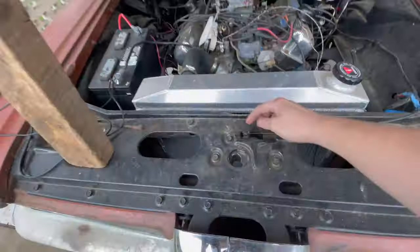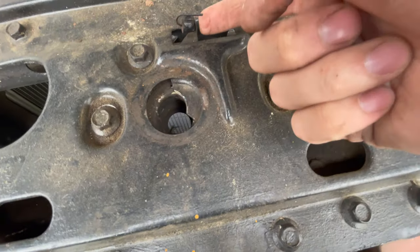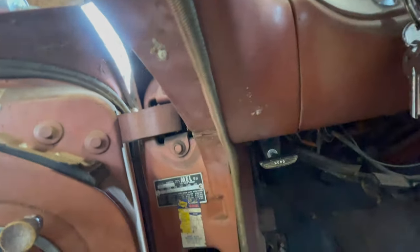We're going to go in and make sure the hub is totally tight. My uncle's here in town — he's done a bit more of this maintenance stuff than me. After that, we need to look at getting the hood to close because it still doesn't close. I think it's this cable — it's just hanging up, not doing the release properly, so when you push the hood down it doesn't have enough time to latch back. I put a little WD-40 in there but it didn't seem to do anything. We may need to find a new cable — maybe a Fairlane one fits, or a universal one.